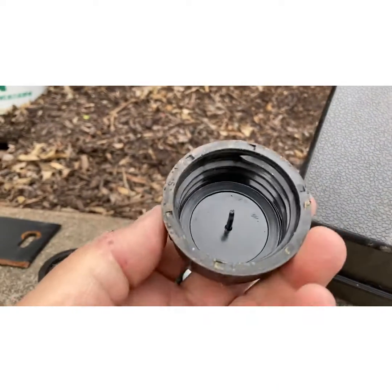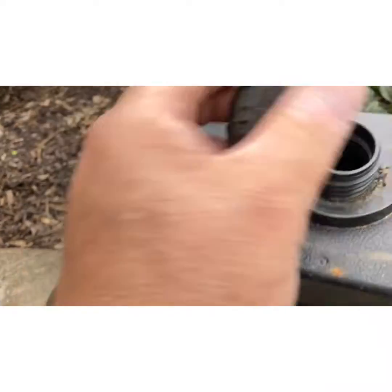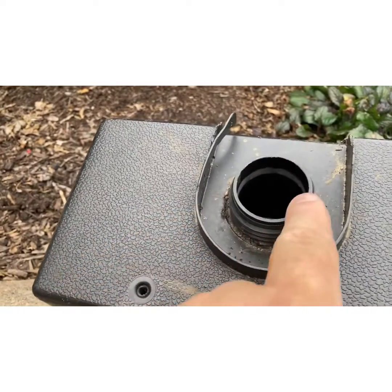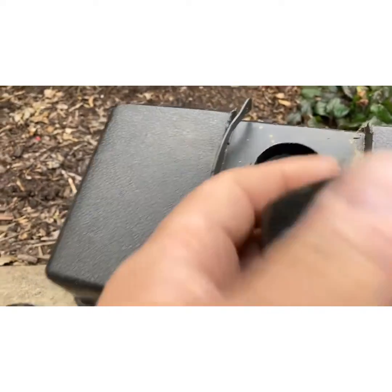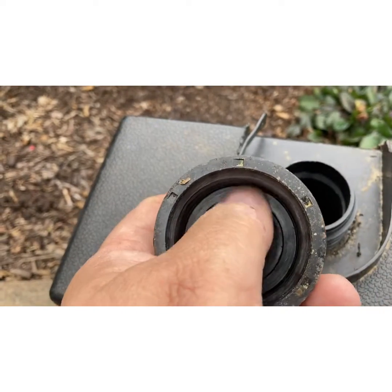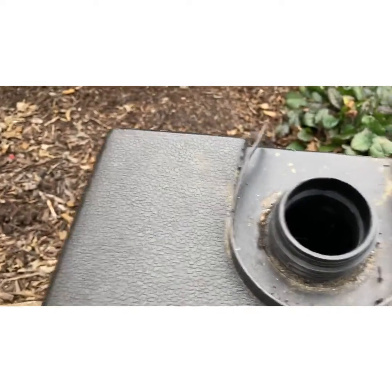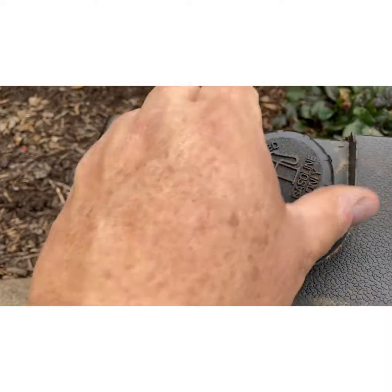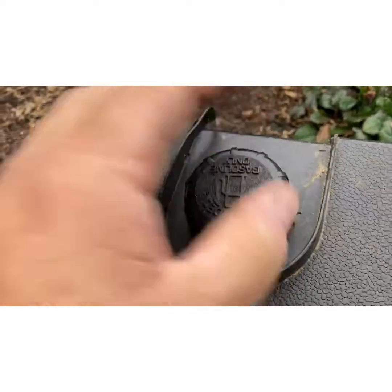Here's the worst case — it's missing everything. There's no rubber, no metal, nothing. So when you take this cap and tighten it all the way down, the top piece is flat and it's going to seal directly against the hard plastic — there's no rubber — so there's no vent. If I put a cap like this on a machine, that sucker's going to die after about a minute, maybe even less.